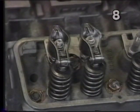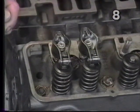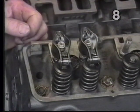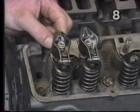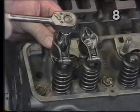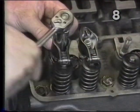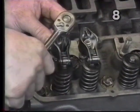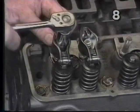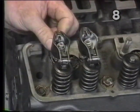After completing all the push rod and rocker arm assemblies, we want to take our wrench and turn the crankshaft one quarter turn. Now we've rotated the crankshaft approximately a quarter turn, we have also changed our lifter position on some of these assemblies. Some assemblies will now be loose and others will have more tension on them — we want to concentrate on the loose ones. Those are the ones where by lifting up on the push rod we see they have play in them. So as before, we start turning the nut down and tightening it until we've removed all that looseness, which can be determined by moving the assembly up and down, spinning the push rod gently, or watching the plunger in the lifter until it starts to move. Once we've achieved zero lash on a rocker arm assembly, this procedure must be repeated to find all the loose ones.